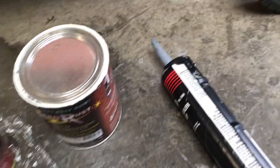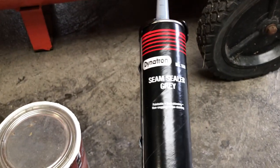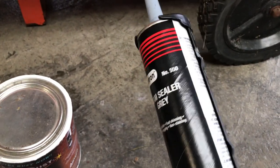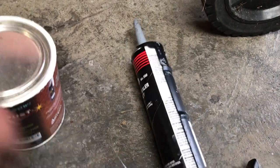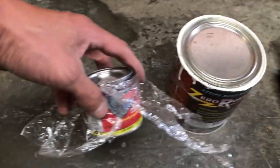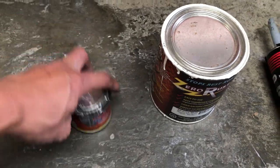The third one is the seam sealer. You can purchase this anywhere online or at a local parts store. I've used about two of these to cover the gaps underneath the car between the metal. And unfortunately, the 240SX S13 chassis did not have an OEM sealer underneath the car. So this is definitely an upgrade. It's nice to have this 30 years down the line.